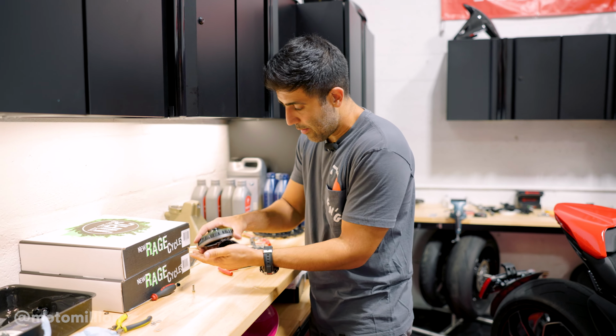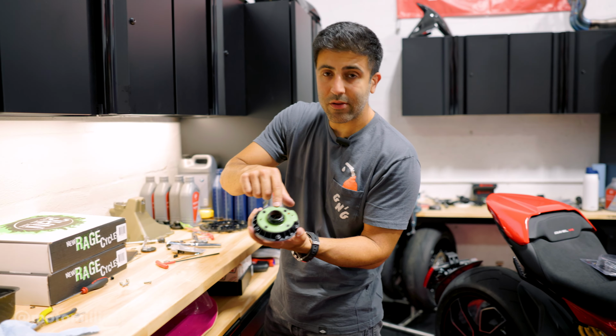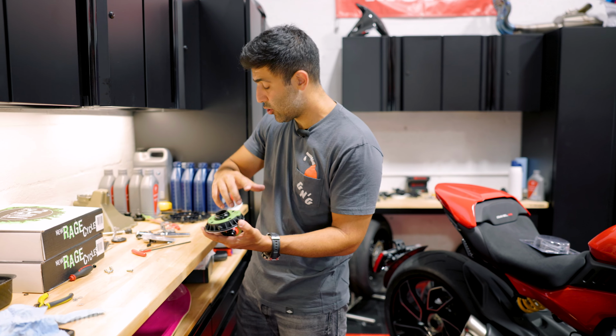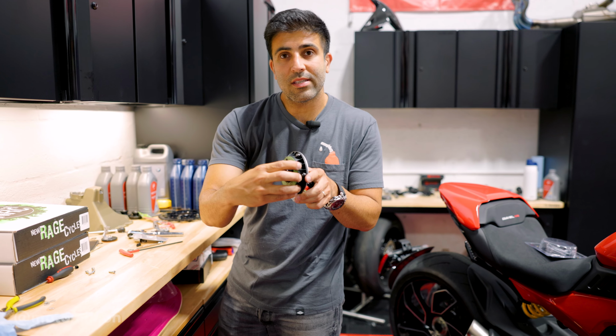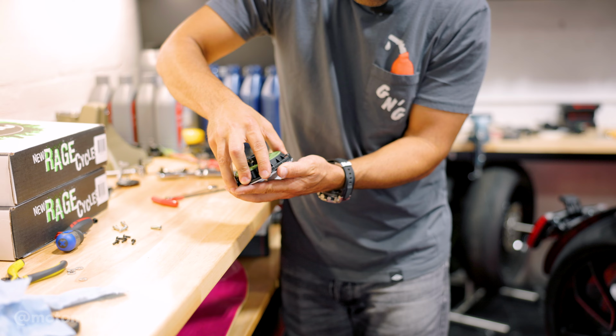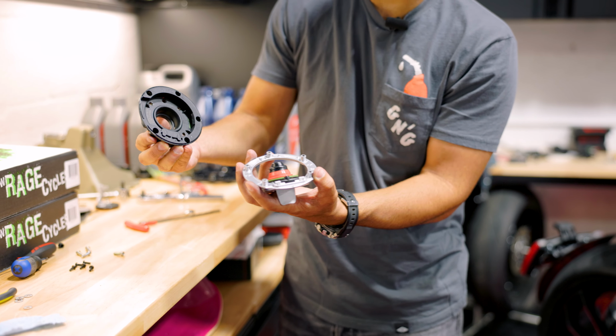So this is the fuel cap assembly. I'm going to remove the bolts away from it. And the flange is this piece that you see over here. We're going to have to get our Phillips screwdriver, take this off, and then transfer this flange assembly over to the TWM one. So there you go. Now that the Phillips screws are out, this should just come apart just like that.